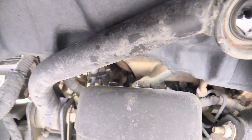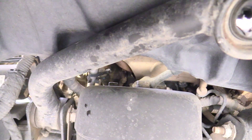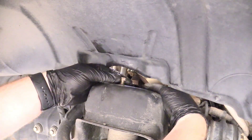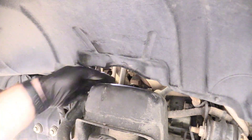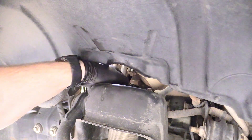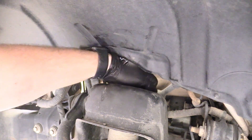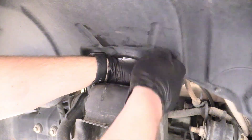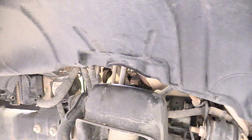Where you're looking now is the top of the coilover. There are three bolts you can get through the side with a wrench, or you can get at them through the engine bay more easily. These run tight — I had to use a breaker bar. These are not 14 millimeter like the stock spec says; these aftermarket ones are actually 9/16ths, which is unusual American sizing. On the stock application it's probably 13 or 14 millimeter, and I believe those are nuts on studs, so you should get new nuts with a stock replacement — just use the new ones.